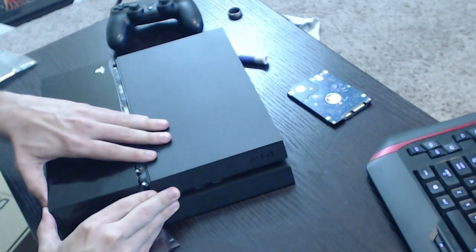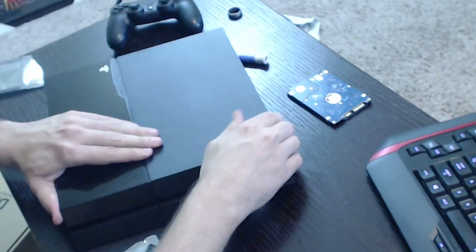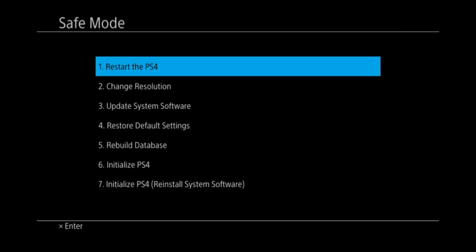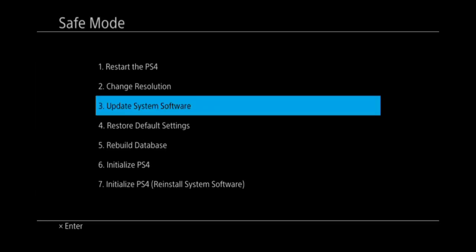What a lot of people don't realize is you actually have to have a piece of software — I'm gonna link you to it in the description below. You go there, download a file, and you need a USB stick. Basically, you get this file from the link — it's a PlayStation.com URL, it's in the description. You put that into the PS4's USB slot, and you'll also want your PS4 controller attached via USB. Then hold down the power button on the PS4 for seven seconds until it beeps twice.